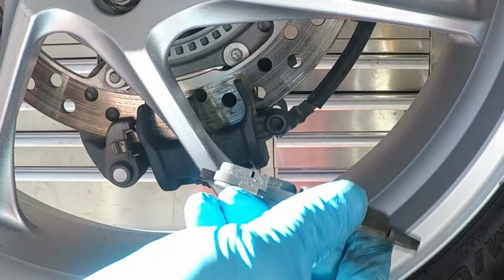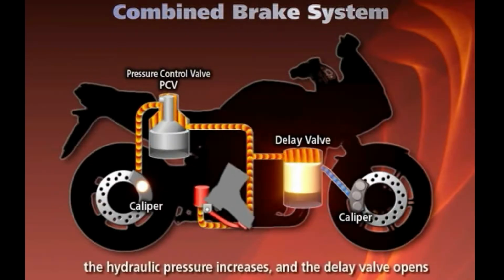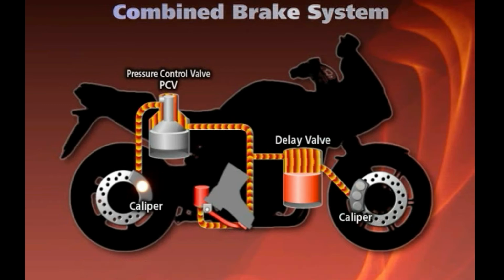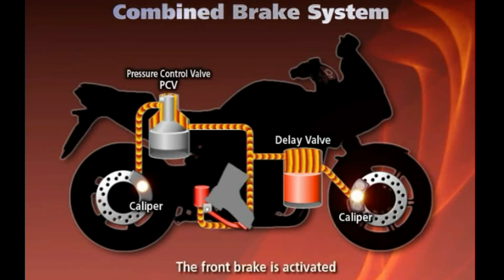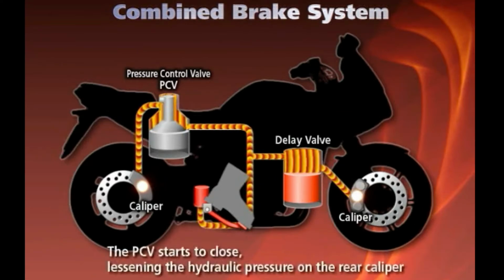The reason for this is the Honda Linked brake system, where the rear brake pedal also applies brakes to the front left. The previous rider was probably heavy-handed with the rear brake and had replaced the rear pads recently, but failed to do the front, since these pads cost twice as much as the rears, and replacing them you have 2 calipers, so the parts alone are 4 times the money. It also appears that the rear brake fluid was recently flushed. It is significantly cleaner than the front fluid.